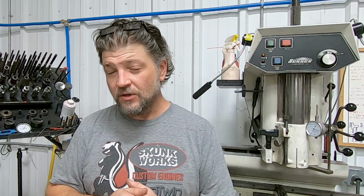And the reality is those cracks could have come from several places because of all the welding done on that cylinder and the fact that it is cast iron. It's gone through a lot of heat cycles. And then the machine work on the base of the cylinder and drilling the hole. With that cast iron, it's quite possible. Too many heat cycles made it brittle, made it crack. So we are just going to hope that it holds up.